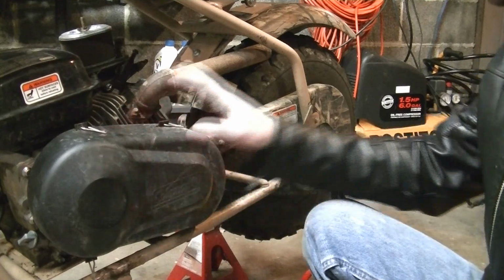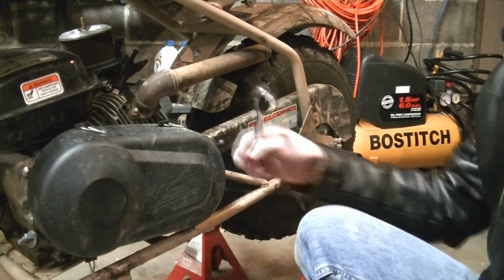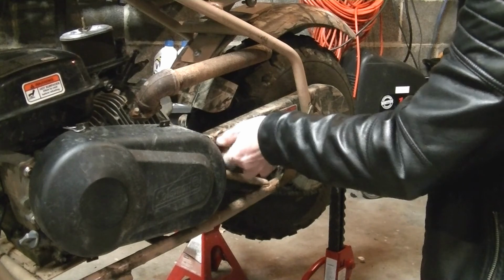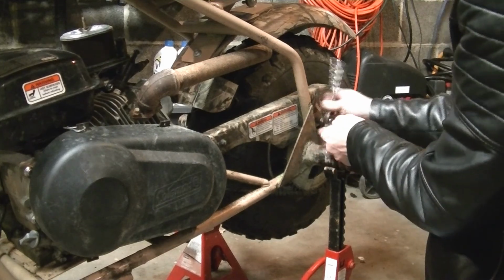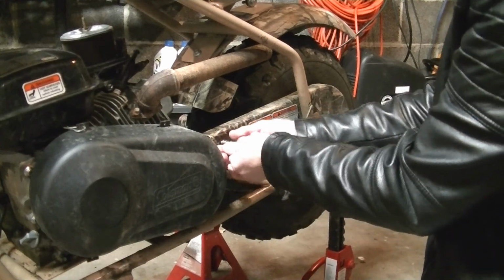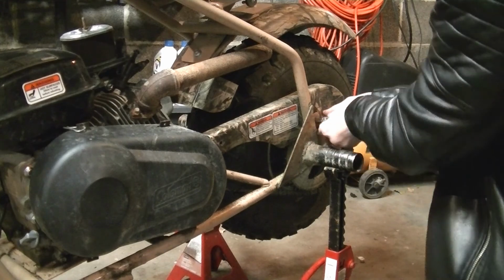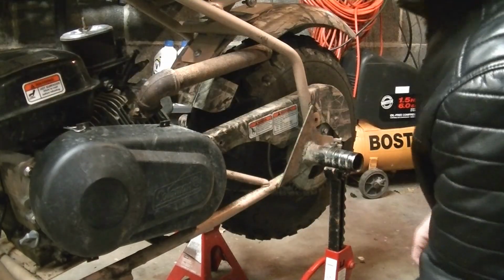So I'm just going to take off this guard and this guard with simply one of these and a pair of needle nose pliers to pull these little guys off right here. Simply 2 bolts. Very easy to do. Quick trick, just take the socket off of the ratchet and you can get them out a lot quicker once they're loose. And a magnetic parts tray. Absolutely a must when working on any sort of car, truck, this sort of thing. Just throw them up in there, no problem.